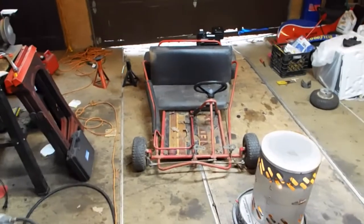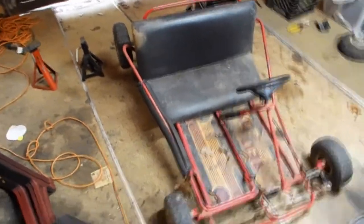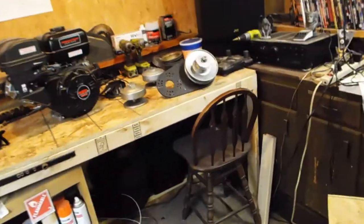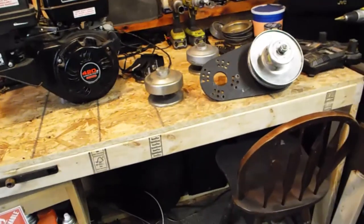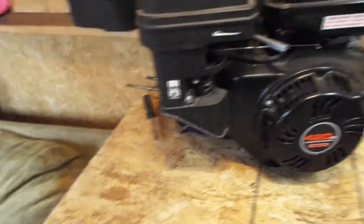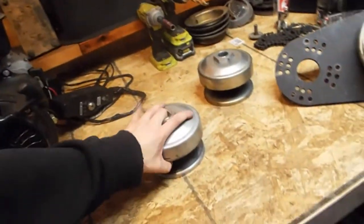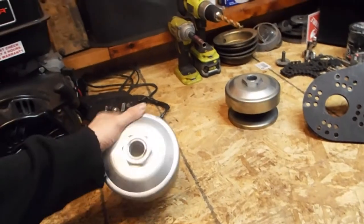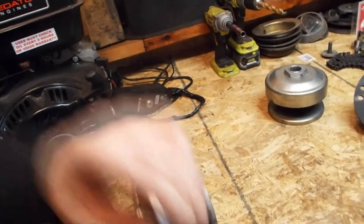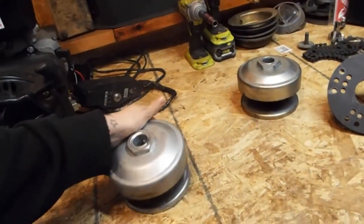That's what my red fox looked like prior to becoming a four-seater — no roll cage, no live axle. Anyway, we got him right now. I want to talk about the 40 series torque converter kit and the 420 Predator engine. My main issue is with stopping — this torque converter driver pulley is sticking. When you come to a complete stop, the torque converter kit is still trying to push you and keeps you going so you can't fully stop.